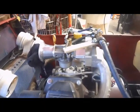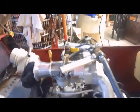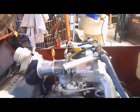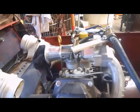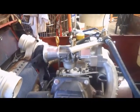I'm gonna go ahead and pull the carburetor off of here and get that float bowl changed out. Alright, that's what we're gonna do. We're gonna pull the carburetor off there. Just a couple bolts. Take the throttle cable off. I think I can do it right here. Use something to catch the fuel. Shouldn't be any fuel left in the bowl. If there is, just very little. So I'm gonna go ahead and get that pulled off, and I'll bring you guys back.